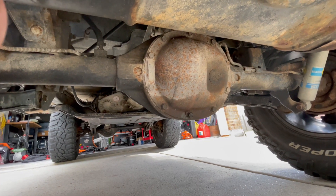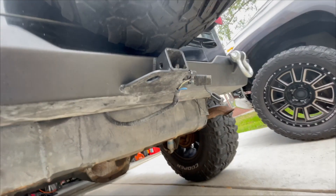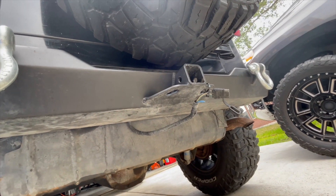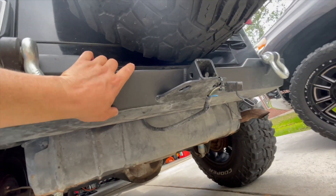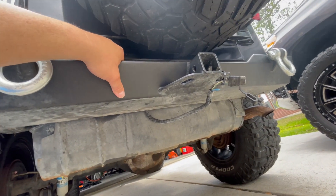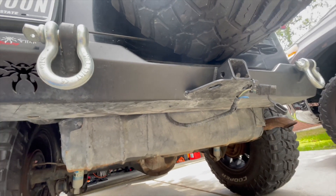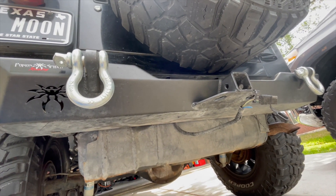This would be more under advanced towing — we're going to keep the simple basics as using tow hooks, D-rings, and tow points on vehicles that were meant to be used. Be careful about just attaching to a standard bumper because a lot of standard bumpers are made just for impact and not made to be pulled on, as their connection to the frame is very weak and only there for impact protection. Aftermarket bumpers that are integrated with the frame and have tow hitches integrated are your stronger bumpers.